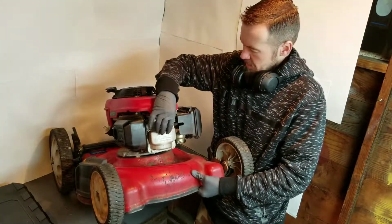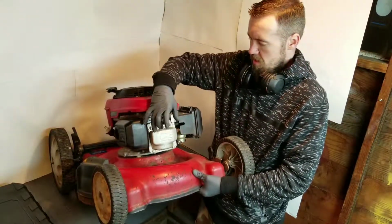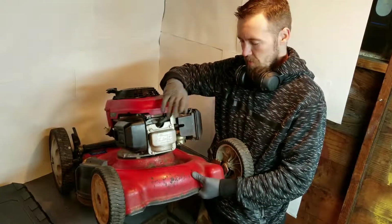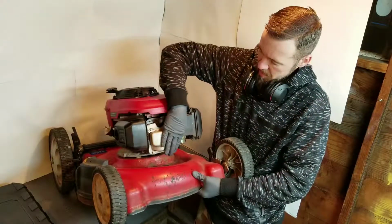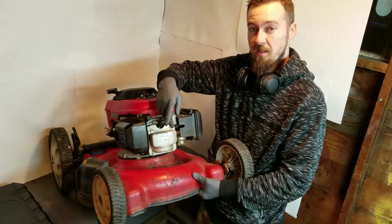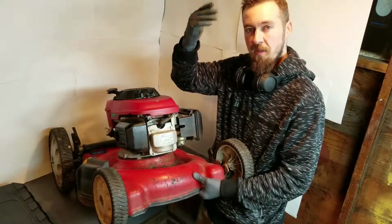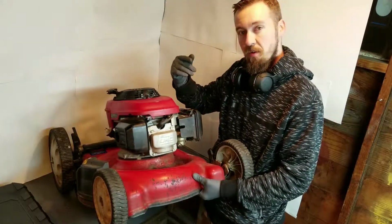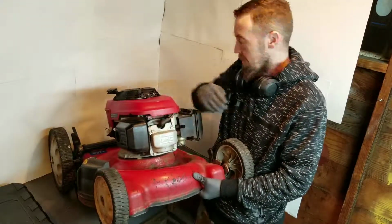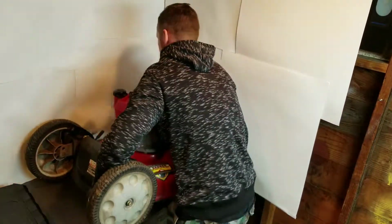So if it's pinched inward, just take this off. It's 4 bolts right here, and then just pop it out with a hammer. Try to be careful with it, obviously, and then that'll be formed right back. It doesn't have to be perfect, but you don't want it hitting the inside internals of the engine there. And then you want to seal it up, of course, so you're not shooting oil out the top. Use some kind of silicone sealant around the sides. Let it dry for a minute, and then put it back. All right, let's put this back in place.